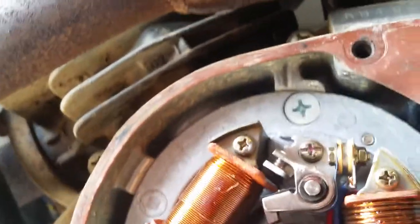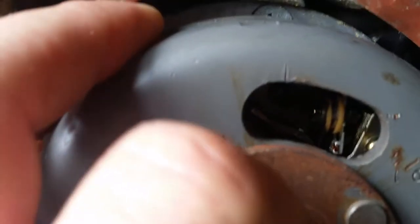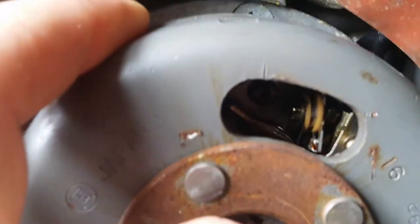Let's cycle this. Where the rotor is, you'll see a line right there. Once you put the two lines together with this screw loose, you line up your mark so the two marks go together. You hold it, press down on the points so it just touches, tighten up your screw, then pull out that little white square we made. Use needle-nose pliers, and you are gapped. It's that simple.